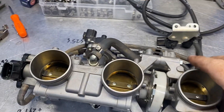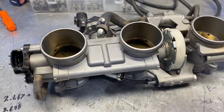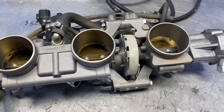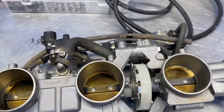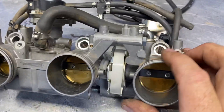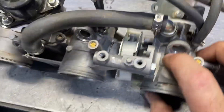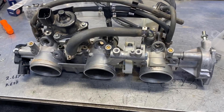This is a really cheap and easy way to do this. We've been doing it on cars running 35 pounds of boost with no issues. When you turbo one of these for the first time, you'll learn that these hoses — especially this big one — like to come off, and that causes basically a dead cylinder. Nice to not have that happen.